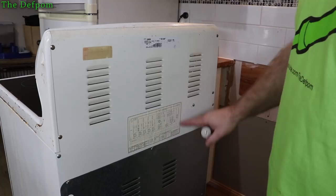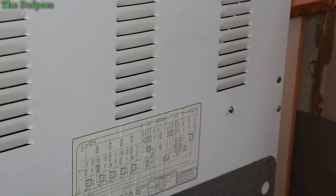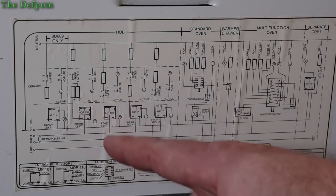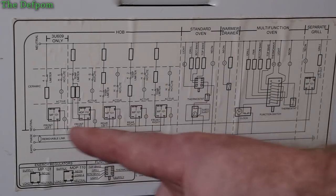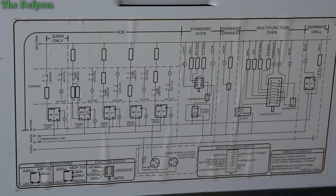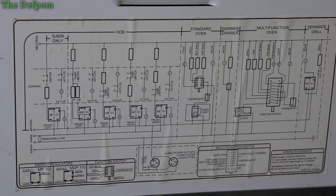That's the cover we've got to take off, and on here you might be able to see there's a circuit diagram of the actual oven. That's going to be really handy — have a close look at that. There are a couple of these devices here we've got to replace. There are two different versions of the oven shown here — it's an extra hob or something like that. It's just these MP-101s that are in here. Hopefully that's all we've got to change.